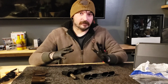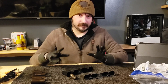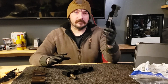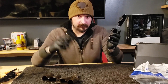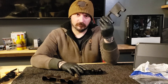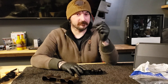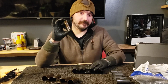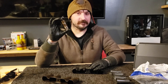The way I get around all that is by going to my local Chevy dealership. You can call them, ask for the parts department — they do have a parts department, not just car sales. Tell them you need a set of lifter trays. They're not that expensive relative to an engine rebuild. More expensive than the cheap pack — this cheap one is $13 — but you might get one GM tray for the price of the whole cheap pack. A good set of GM lifter trays will run you around $50 to $60.